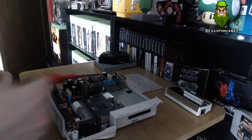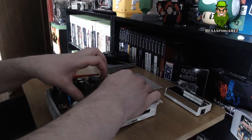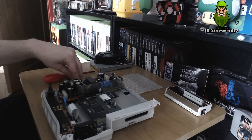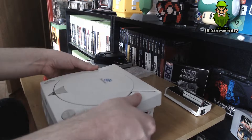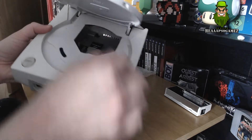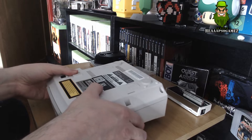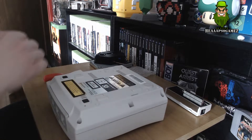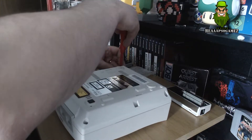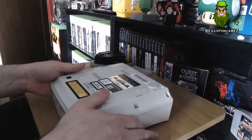That's it fitted. You can do this next step with the lid on or off - pop in the SD card. We'll go into detail in a moment about how you build the SD card. Slot it in and the mod is done. Store the screws from the old disk drive, then pop the lid back on flush. When you open the tray you can see the SD card is in place. Be gentle when removing or inserting it. Click down the tray, gently turn it over, put the screws back in, and click the modem cover back in - and there we have it.